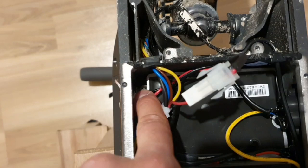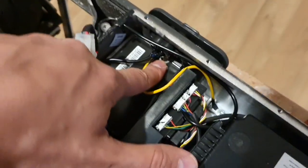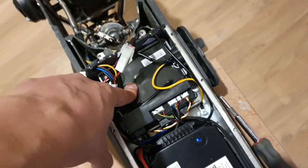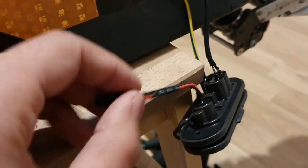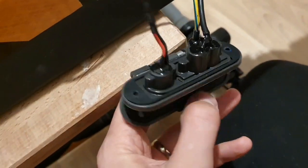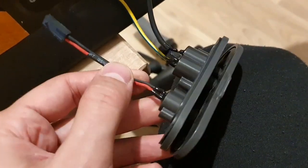And there is one here, one is down there, and the third bolt is, I think, right here in the middle. So three bolts are holding this charger, the internal one, that charges normally with 3 amps or something like that. As you can see, I unscrewed this part and unplugged the connector. This is for the fast charger, actually, the port, and we are going to use this to charge the internal battery directly.